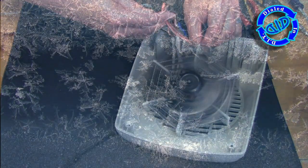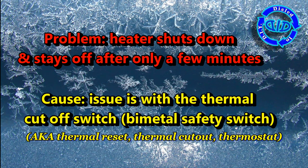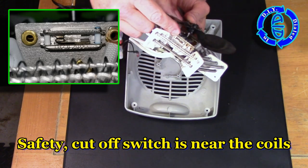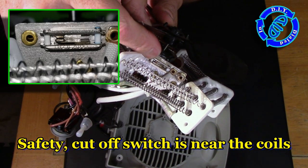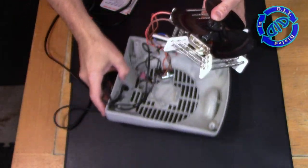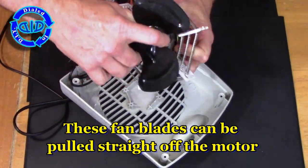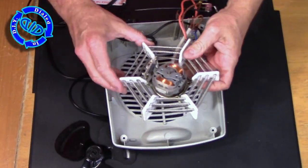The great news from a salvage perspective is I was able to figure out that all of the main parts work exactly like they're supposed to. The reason the heat shuts off is actually because of a thermal switch, which is a bi-metal safety switch that turns off the power when it thinks the heater is getting way too hot. The problem with this switch is that as soon as the heat starts to turn up at all, it shuts off the heater. The fan can keep working because that helps cool things back down, but it won't let the heat run, so it's pretty much useless as a heater.